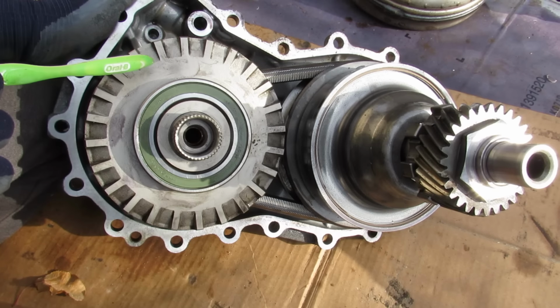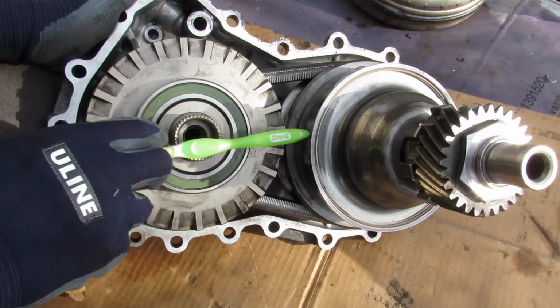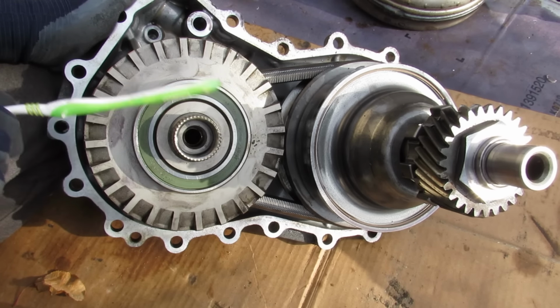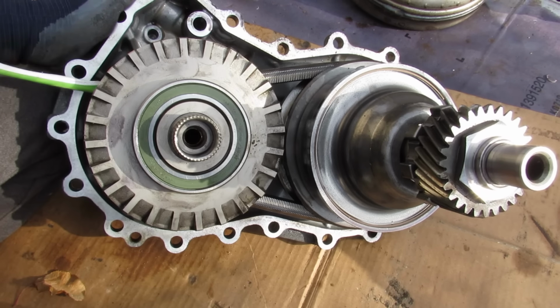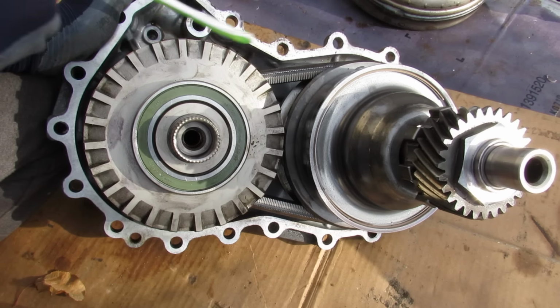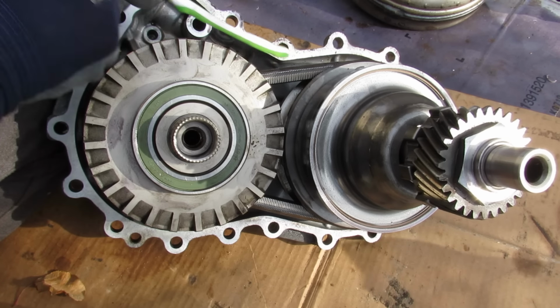Now, on some CVTs, these actuators are adjusted by hydraulics, and on some they're adjusted by an electric servo motor that actually moves it in and out. This one here is hydraulically driven. You can see these here are the ports where the oil is going to flow from the transmission casing into these hydraulic actuators to vary their widths accordingly.